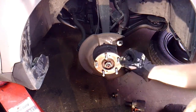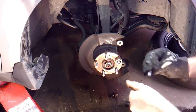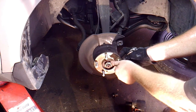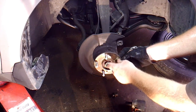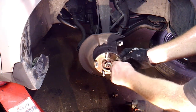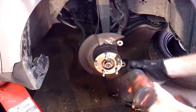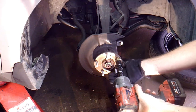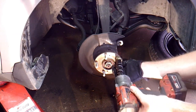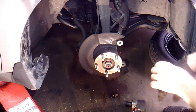I grind down a little bit more, then go ahead and put the nut on. I found these axle nuts work the best, though not everybody will have one laying around. Run it down until it's flush in the back — and that's it. Two new wheel studs installed. Go ahead and put the brakes back together and we'll finish this up.